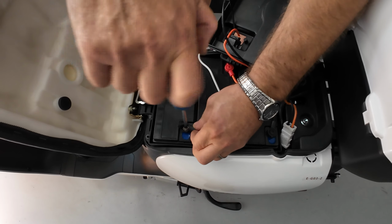That's why this particular scooter, oops, I'm sorry, that was a big spark. I should warn you about this and turn off the breaker switch when I reconnect the wire. Every time you reconnect without turning off the breaker switch, it's going to make a little spark. I did not expect to do this because usually I'm more careful by turning off the main breaker switch.